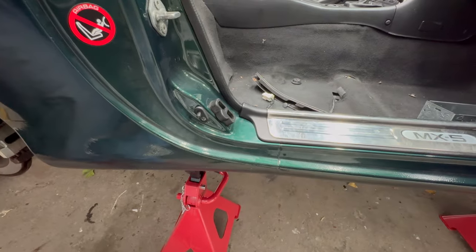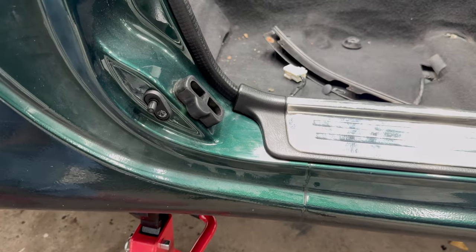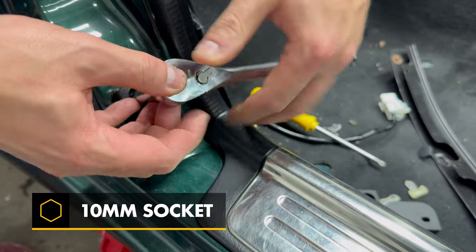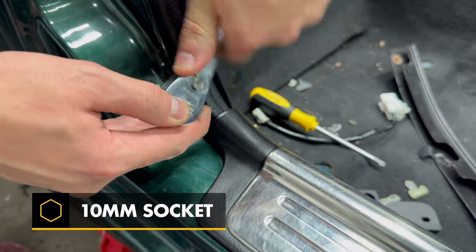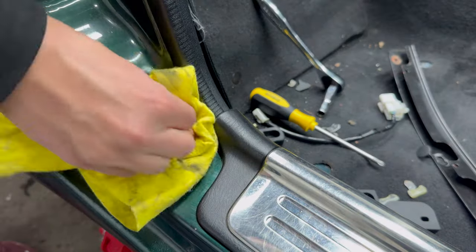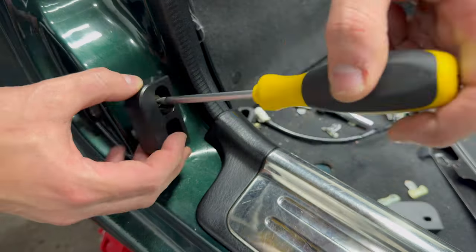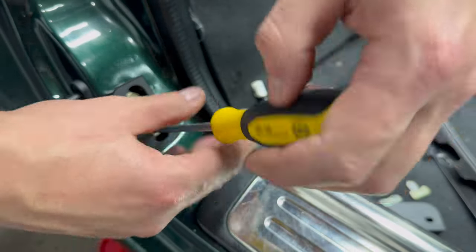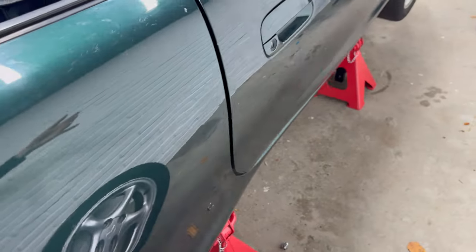Then the door bushings. Apparently the existing rubber ones are bad, because they allow for the door to flex somewhat. I have no idea if this is true, but I couldn't resist ordering new bushings, so let's get them installed. Removing them is easy. When installing the new ones, make sure to leave some play, and smash the doors a few times to get them properly seated, before tightening the bolts.